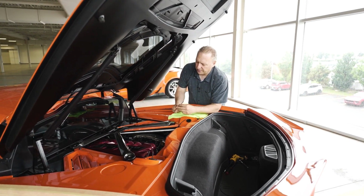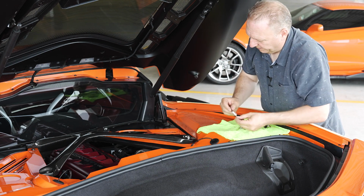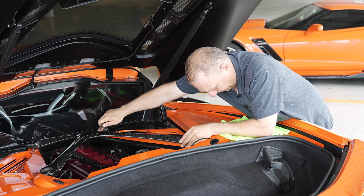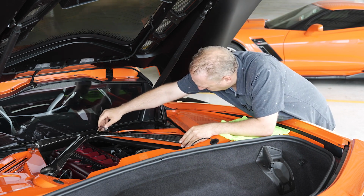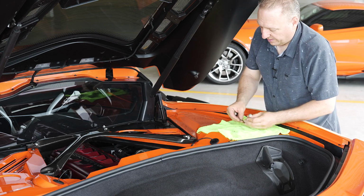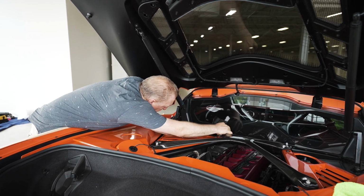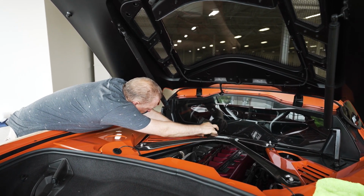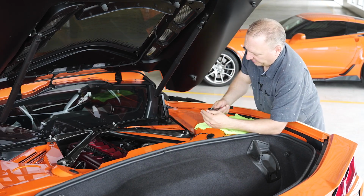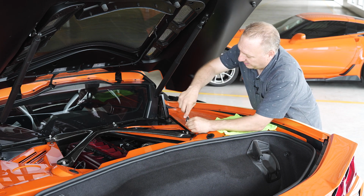There's a washer supplied with the bolt. And starting all my fasteners. And I'm making sure to put my Corvette logoed bolts towards the rear of the car. The bolts themselves are a female Torx, and I don't have my female Torx kit with me. So I'm actually just using a 5/16 12-point socket. It's doing the trick.